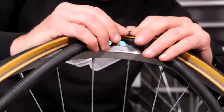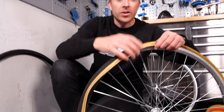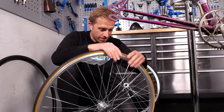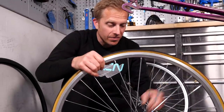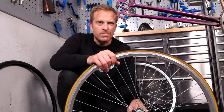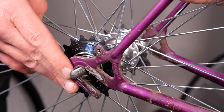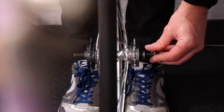Let's just hope these inner tubes can go inside now. My heart can start beating again after that - a bit of a heart-in-mouth moment. We'll pump those up shortly, but first of all we just want to make sure the wheel goes inside the frame okay, because older wheels tended to have different size axles. What I'm going to do is space out between the dropouts with quite a few washers to pack out this axle, just so I don't have to crush the frame too much. There's a bit of play there - a little bit of closing of the dropouts - but that is far too much for comfort.